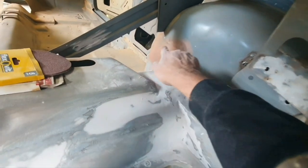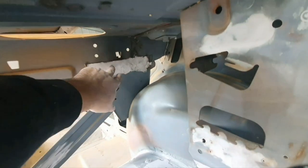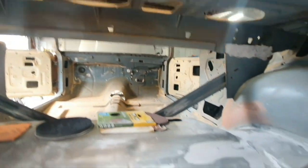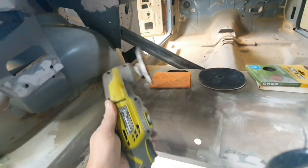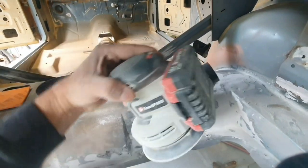This was all rusted out, all up in here — it's pretty bad. What I've done, I've taken out these arms for the boot and the rods — they're going to have to get painted separately. But what I'll do now, I'm getting filler where this has all been, the spot welds have been drilled out, and just filling all those little areas. It's come along really well. This is the fiddly stuff, but I've got the tools for it — I've got this Ryobi 18-volt sander, that's unreal, I've got it for the tight areas, and it really takes the meat off quick. And I've got this Super Cheap Auto orbital sander, which is really good. I've got a backup battery so I don't get left with a flat battery.